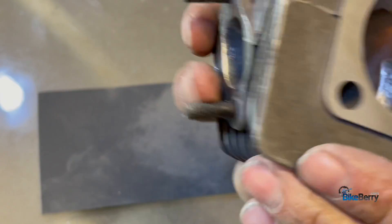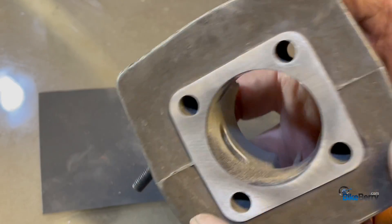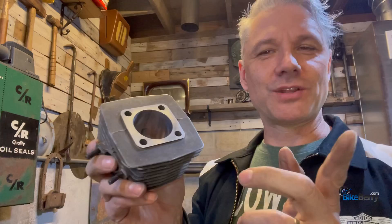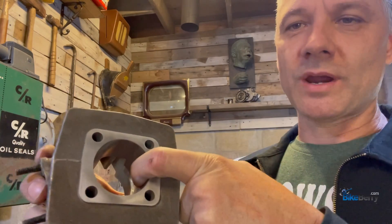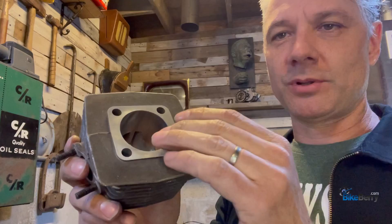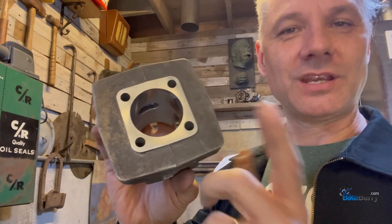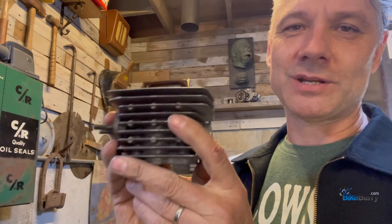You can check it out — it's going to look pretty good. Keep doing that until you're satisfied with it and you know that it's even all the way around. It's a pretty simple procedure. You just want to make sure this is perfectly flat and square with your bore, and that you don't go down too much. You really want just one millimeter, because you don't want your spark plug banging into your piston or anything like that. Give it a try — let us know the results that you get with it, and we'll keep working away on porting and modifying your motorized bike engine.